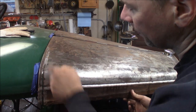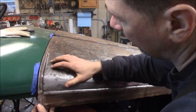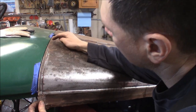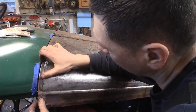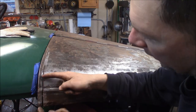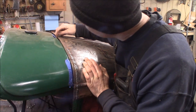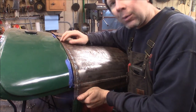I've cut the slit in the hood here and I almost got my finger with a sharp piece of metal. Now we can see the gap here is good — it's behind the blue tape. I've got an eighth inch clearance now, pretty much all the way across. So I'm just going to take the welder, tack it here, then work it around, tack it, and weld the edge of this hood back up. I've also done a little slice on the other side just to clear the firewall. The seam is all welded up — just a little bit over an eighth inch all the way through. So it's good; it won't chip the cowl anymore.